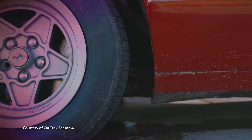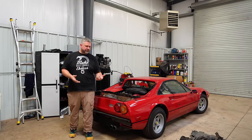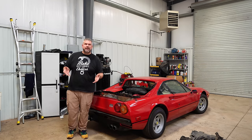It had four carburetors, not just one. It had a total of four set up. And normally they can work pretty well. But if you build too extreme of an engine, too much camshaft, there's just no practicality of tuning them, especially if you only have $30 of parts off eBay to make them work.